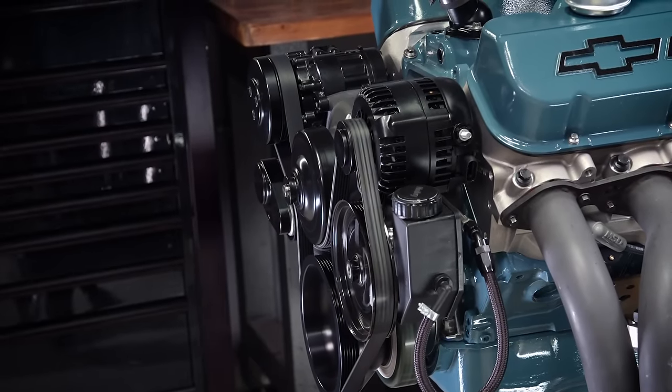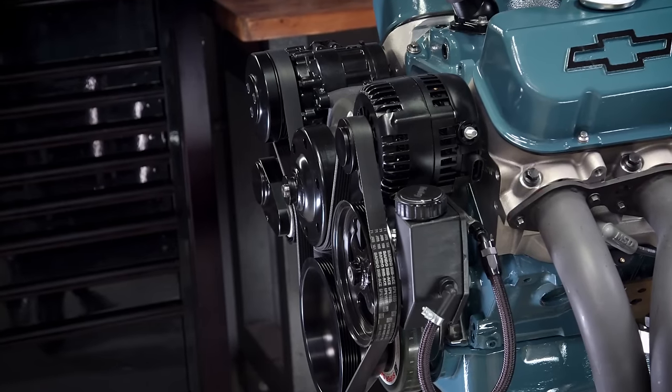This engine looks great, and we're genuinely excited for whoever wins it — we almost wish it were us. It has a full accessory drive, starts and runs smoothly, and is truly a drop-in swap. You could add a larger spacer and potentially pick up more power, but as configured it has plenty of hood clearance. It's not making crazy power requiring an expensive drivetrain — for pump gas, it's a pretty stout, practical swap engine. Pump gas performer.